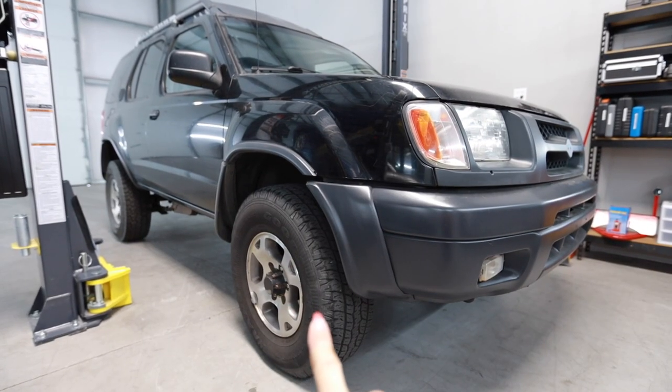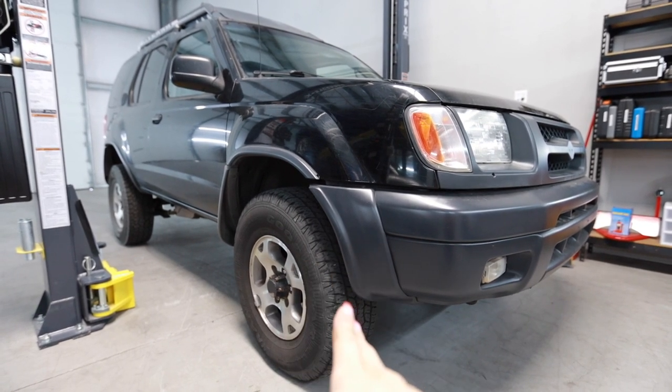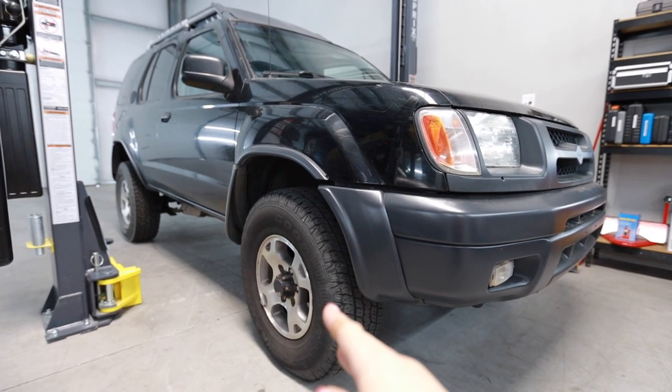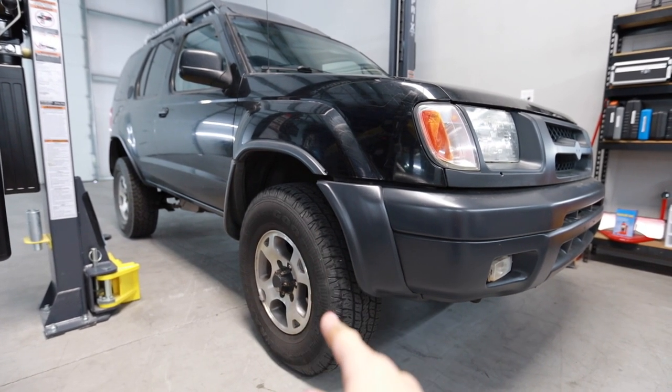They have a fatal design flaw on the 4x4 models. The way the hubs were designed on these, it allows you to use four-wheel drive as long as you're driving forwards. But if you get stuck and you need to go in reverse — like what happens a lot of the time when you're off-road — it will pop it out of four-wheel drive because of the way these automatic lock-in hubs are designed. It requires torque applied to the hub to lock it. So if you're stuck and you go put it in reverse, you're kind of boned. It will actually lock in reverse, but you have to move the vehicle physically for a little bit for it to lock in.